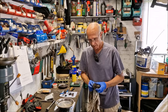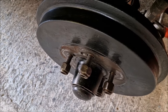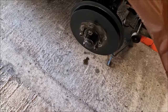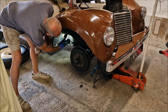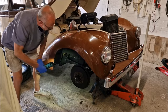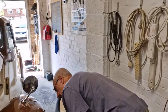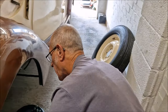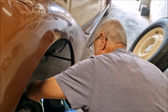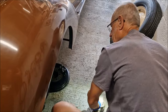What else has been done? Dad stripped and cleaned all the hub down on the offside and checked the gaiter boots - they're still fantastic, they're leather. He also put a new boot on the drag link - that came from a Peugeot. Now we head around to the near side. There's a girling brake park clamp on it, and the track rod end boot has got some sort of two things wedged on it - he'll need to take it to bits and have a look at what he's dealing with.